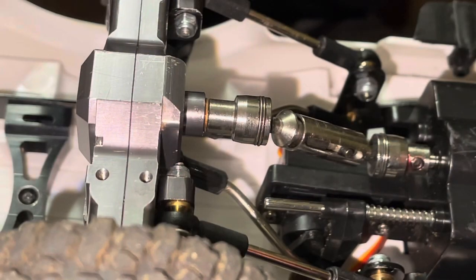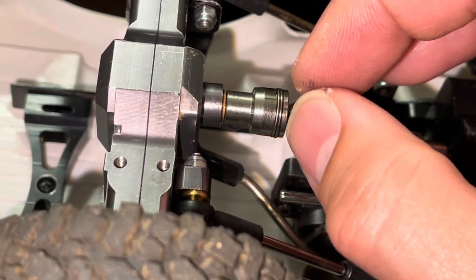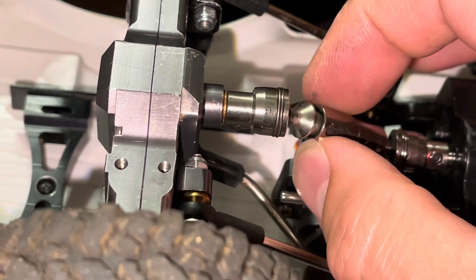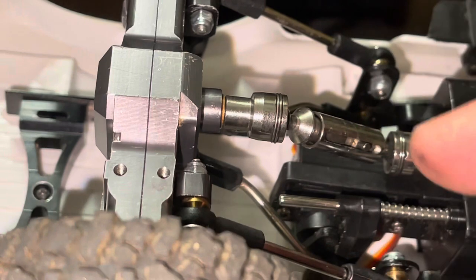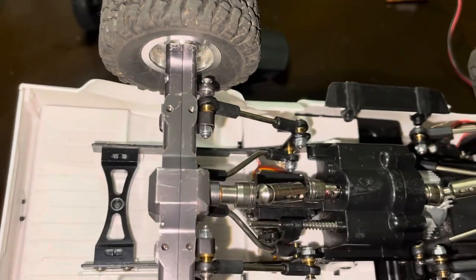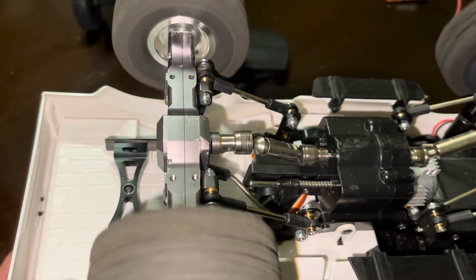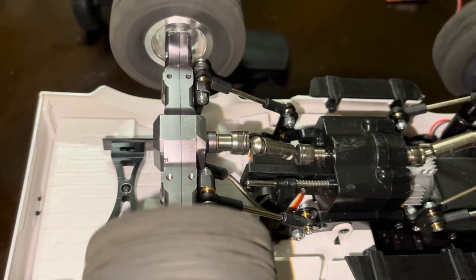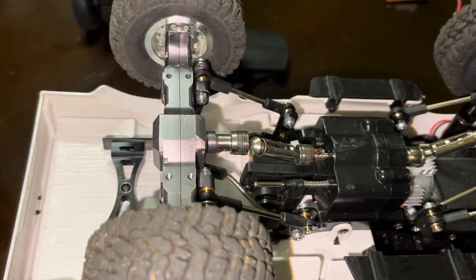All right, so we have the axle back together, and as you can see, with the little brass spacer in there, all we did was pull the pinion out as far as we could and slid the drive shaft on there, and now you see there's very little play before it actually starts moving. There's more play in this drive shaft than anything, but there's hardly any play in that rear end now. So that's how we like to set it up, put shims in it, use automotive grease, and everything ends up working out well. We'll go ahead and check it real quick. Pretty good. That's low. That's high. So everything's tight and exactly how it's supposed to be. Hope this helps. Thanks for watching.